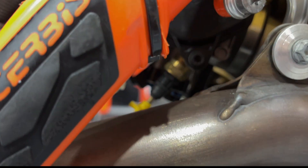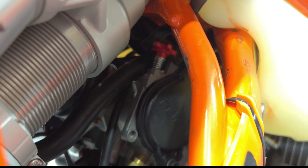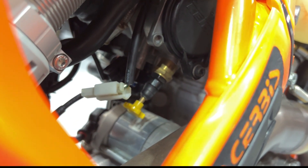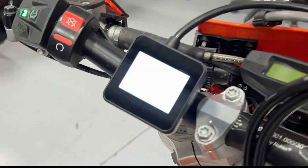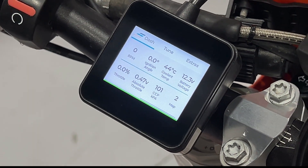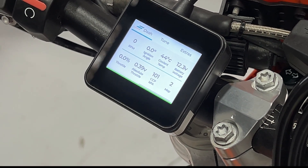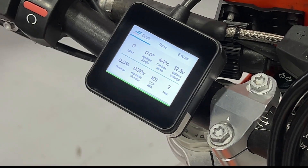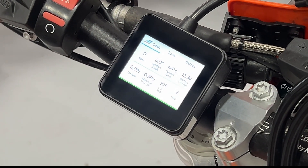Coming down to the throttle body, we can see where the red and yellow adjusters are. The red adjuster is on top of the throttle body — that's the one that sets the idle speed. The yellow adjuster is underneath and essentially gives you the fast idle; when you push it upwards when the bike is cold, it allows the engine to idle much faster and warm up quicker. I'm going to reach in and wind back that red adjuster. Watching the ERM screen, you'll see the voltage drop as the butterfly slowly closes to its fully closed position. The voltage isn't dropping anymore, so I'll check the yellow one and wind it back a few turns to make sure it isn't holding the butterfly open at all — and it's not.